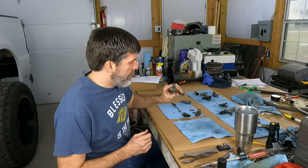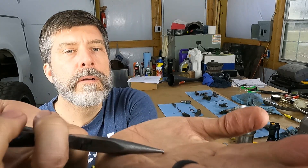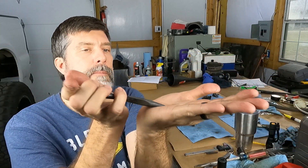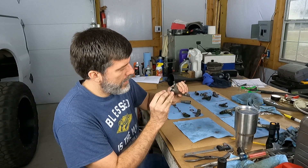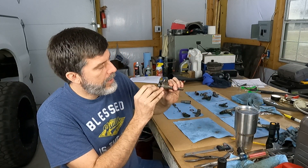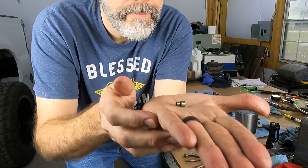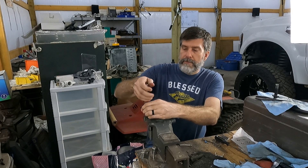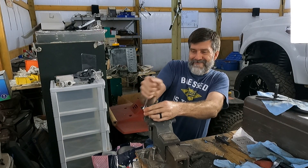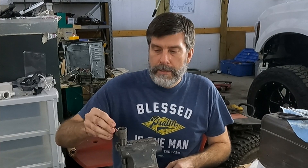I'm back at the workbench again for the last couple of little pieces. There's this little bitty nipple inside there. That nipple is sitting on a spring, and that spring is riding inside this last little piece. The last thing to pull off is this filter — the nozzle where the fuel comes in. I suspect since I didn't find any metal shavings inside the injector so far, this filter caught all of the shavings that were coming to the injector.